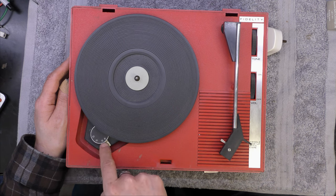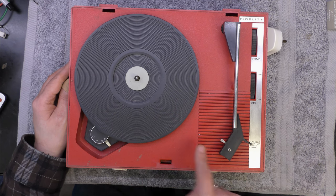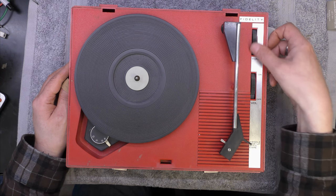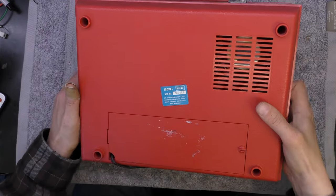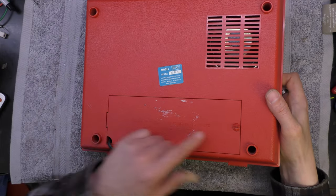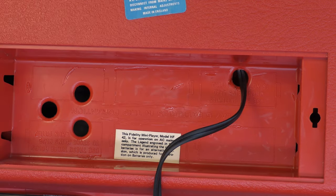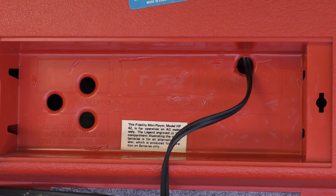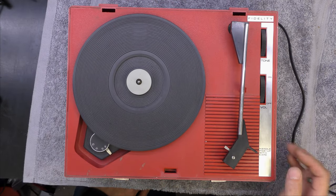Here's the speed selector with a neutral position, so it retracts the rubber idler wheel so you don't get a dink in it. Small loudspeaker, there's an on/off volume and a tone control. Looking carefully underneath, there is a place to store the cable and a small clip. Interestingly it shows a position for 6 batteries, so I wonder if they made a battery version. And there is actually a position for a 13 amp plug, quite amazingly. I've brought it up gradually on the Variac.